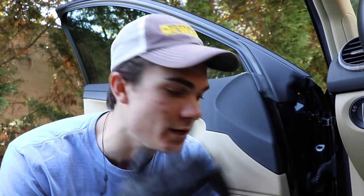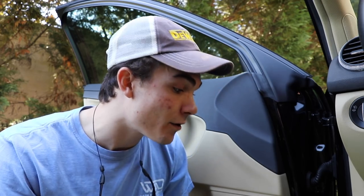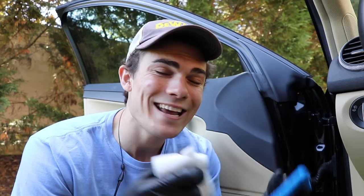For those of you who have been following the Wilson Auto Detailing Channel, you know there are two main ways I approach leather seats. One is a non-abrasive or non-scratch scrub pad with a degreaser or all-purpose cleaner, and the other is the same but with Mr. Clean Magic Erasers. Both tools do great jobs but different situations call for different things — they take different amounts of time and effort. I want to show you the driver's leather seat on this Audi A3 and demonstrate the time difference, effort difference, and different results you get with each tool.